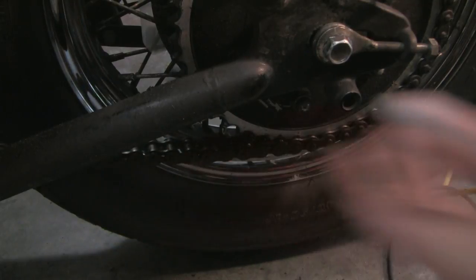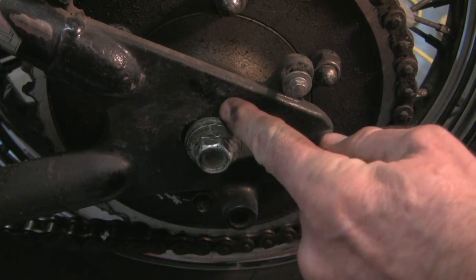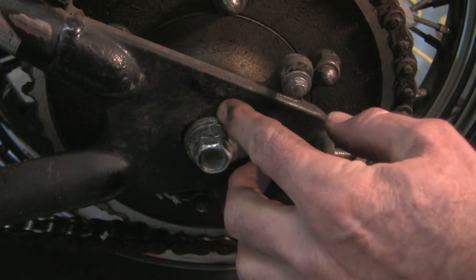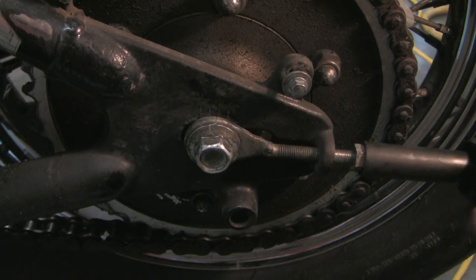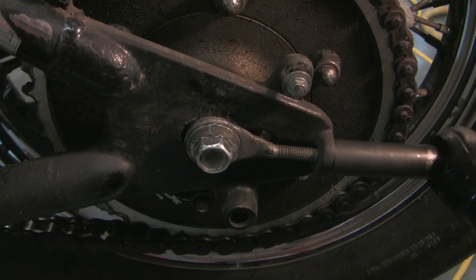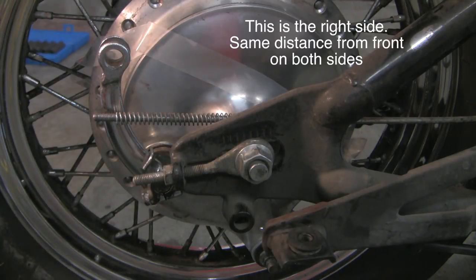You can see my chain is way too loose at the moment. The way you adjust that is with this nut here - you want both sides to be parallel. It's really critically important because that tells you the rear tire is going in parallel with the bike as it goes down the road. There's a mark there and then you can see the hash of marks on this side. We're about four notches from the right on both sides, so we're symmetrical.